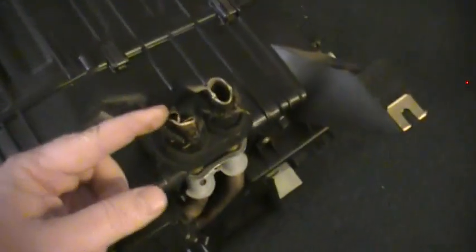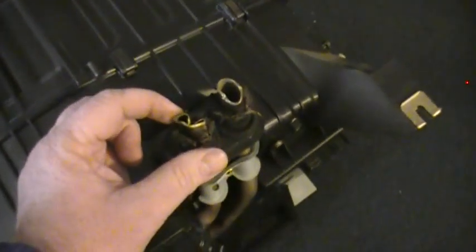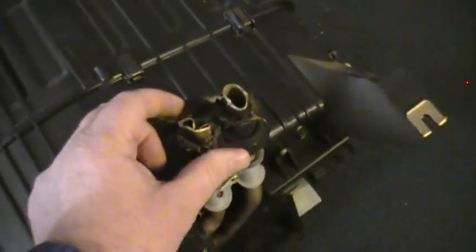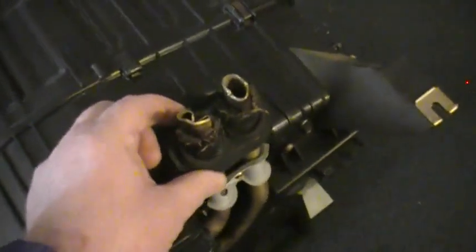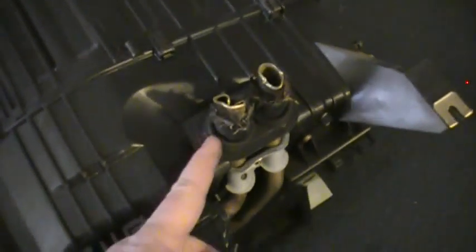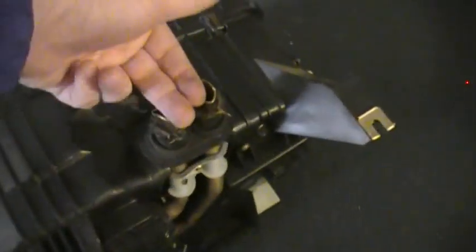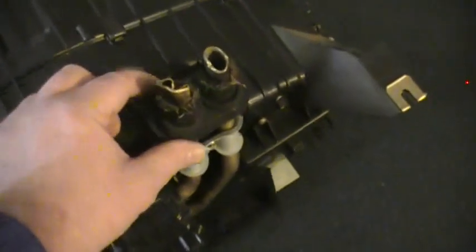So you can see on this side, I was worried that maybe there was a little hose left, because I couldn't really see down in there. So I thought maybe if I squished it, it would give a little bit, and that didn't help out. And this big piece is usually supposed to stay in the engine bay. It's kind of like a grommet to help keep the cold air out and stuff. So basically I got a pry bar, put it up against here, and I was pressing on this side while somebody on the inside was pulling. And we essentially had to overcome and suck this whole grommet through. And then the heater core unit came out.